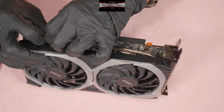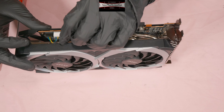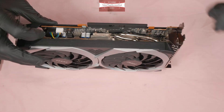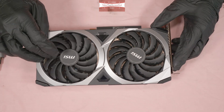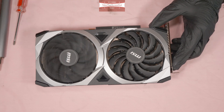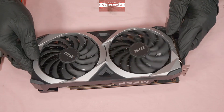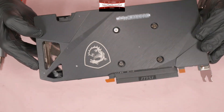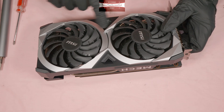It's all done. Make sure to check everything — the fan connectors are pushed in properly. Check the rotation of both fans to make sure they spin freely. Visually check all the screws: three screws per fan.